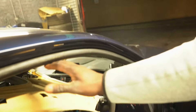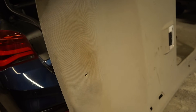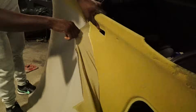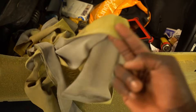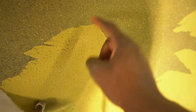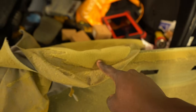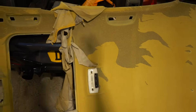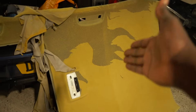So I've got one more mod for the M140 - the headliner. Super easy to remove - I had already started the procedure off camera. When I got this car it had a grey headliner and you guys kept saying I need to get rid of it. I couldn't find one, and I'll tell you how much one costs from the dealer later - but I've come up with a really clever way to make it black. The old grey roof liner has a foam backing and I'm going to try to remove as much of this as possible. I've got new fabric that's like-for-like but in black with a thin foam backing - this is not spending 700 quid on it and we're finally going to have a black roof liner.